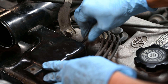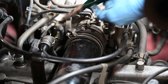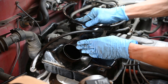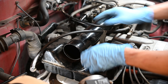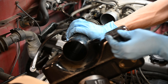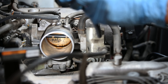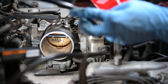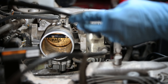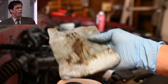Using a pair of pliers to squeeze this clamp and move it aside, then slipping this hose out from the clip — gotta wiggle it a little. Now we have access to the throttle body. May as well clean it up since everything is off — got some throttle body air intake cleaner, give it a nice spray and wipe it down. Just look at all the gunk that came off that throttle body.